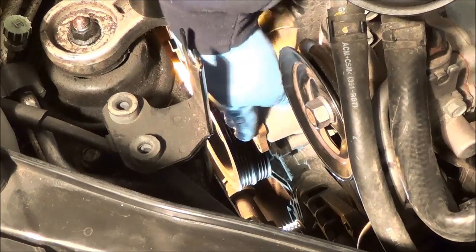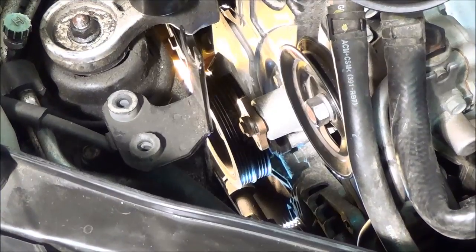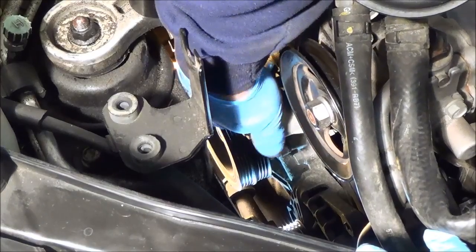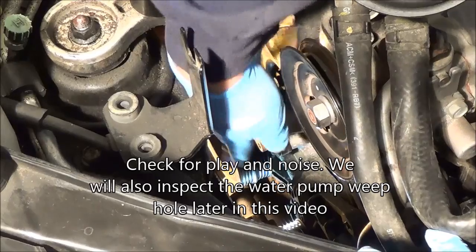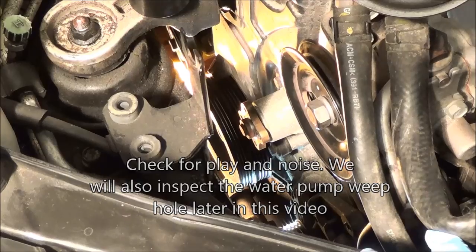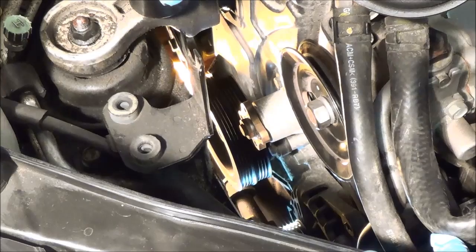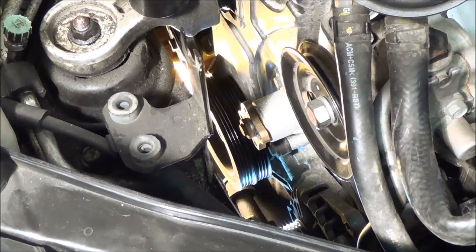Here's your water pump right here. Now at this point you're going to want to test the water pump bearing — just going to want to spin it and listen for any weird grinding noise or resistance. There's nothing on there; that water pump sounds good. I'll show you later when we get the timing belt cover off — there's going to be a weep hole we're going to look at, and that's to determine whether your water pump's healthy or not. I'll show you that when we get to that point.